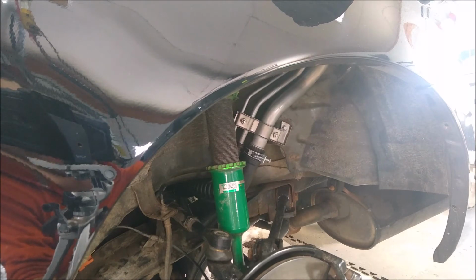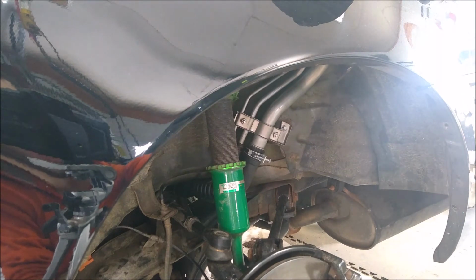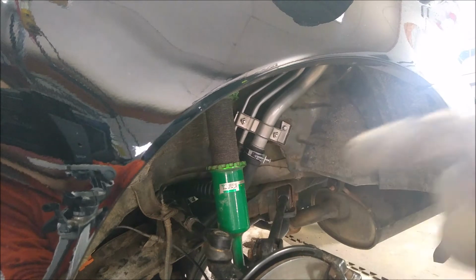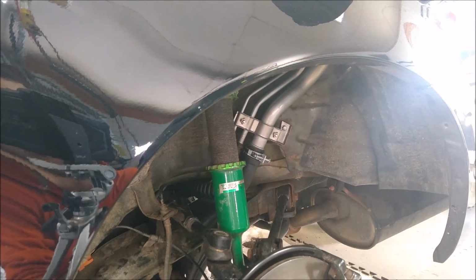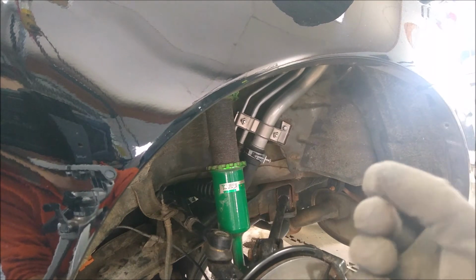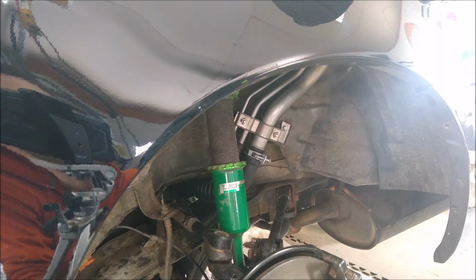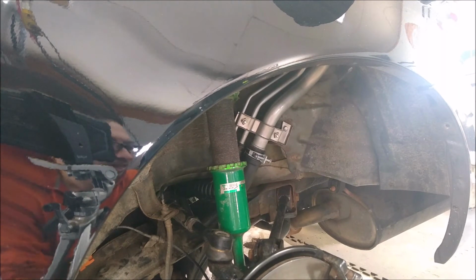And essentially what I did was I took the position of the hose clamp that you can see here, but the one that's inside where it connects to the tank, and faced it down. And I would recommend doing that if you're going to go through this project as well. Facing it down allows you to come up from underneath and then use a screwdriver to tighten it, or use a 10 millimeter socket, either which way. So now it's just about buttoning this area up, putting the plastic pieces back on, and we're done.